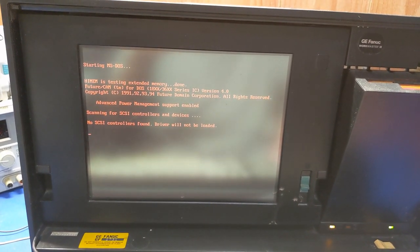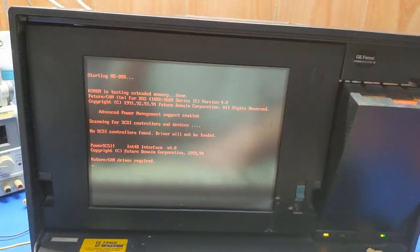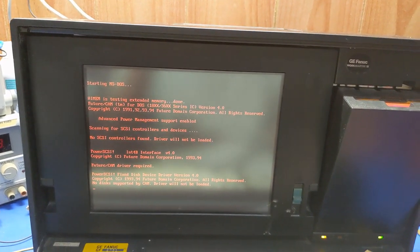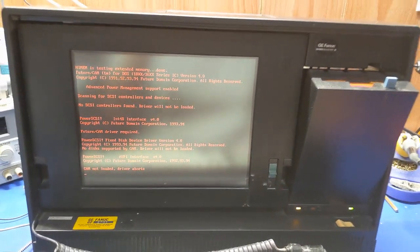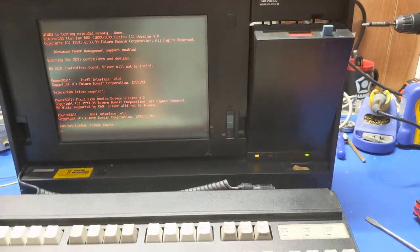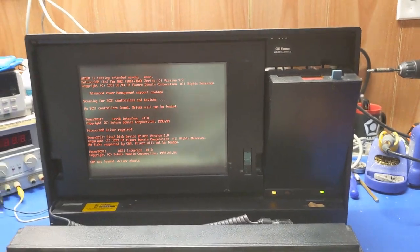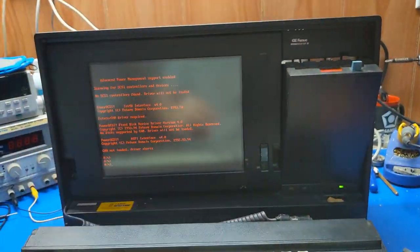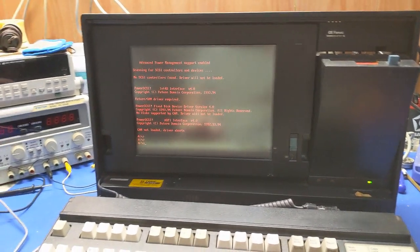working on this thing some more. This is the P70 disk I use that boots my other machine because it's got the SCSI drivers. Because my other machine has a SCSI card because it too had a bad hard drive. And it's becoming a problem because the ESDI hard drives that are direct bus attachment, they're all failing. And there was no solution for storage on any of these old microchannel systems. So it's like, what do you do? You know?